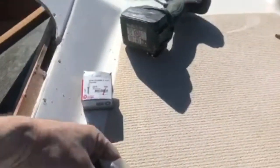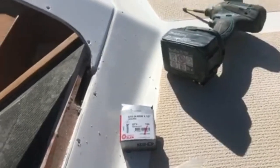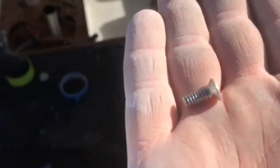Now there are a few odd side screws holding this window in, and what we have done to combat this is we've brought myself some helicoils. We've got 2 in this window here, 1 in there, 1 in there. Now these holes were too big to be able to get a tap in and have this thread work. The hole was too big, so we've upsized the tap, put in a helicoil, which in return will take this thread. So that's my way around getting the same fastening all the way around the window to hold the windows in.